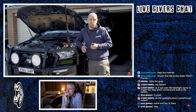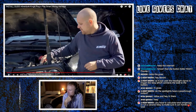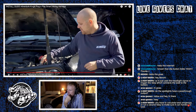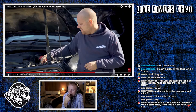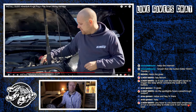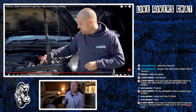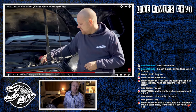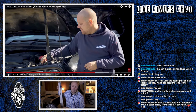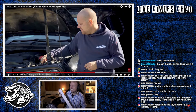How easy is that? We are cruising through this installation. Pretty easy. Now all that's left to do is put the switch into the dash. Now this is a tiny little bit fiddly, but as I mentioned before, I've got a trick that can help here. Hexy, you have to calculate total amperage or run a second relay to make sure it can handle the load. Right, right. Makes sense. I mean, I'm only doing the two lights and the two light bars, so I should be okay, right? It's nothing too fancy. In fact, what I could do is wire up the main light bar and have the secondary one there and just see if... I'm only wiring up the second number plate one, or the second one here, because I bought it. I don't really need it, like...